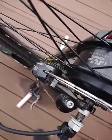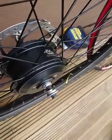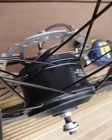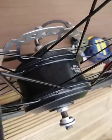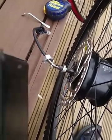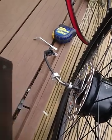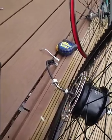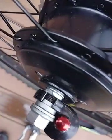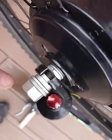One good thing — the disc lines up straight away, which is good. I've figured out that it's actually easier to file it on because then I can use the template to see what I've got to take off, or else I'll have to come off and go into the vice. That was a lot easier to file down — it's just slipped into there, no problem at all.